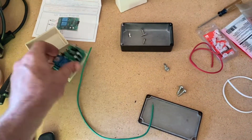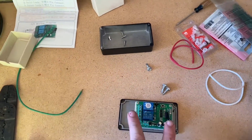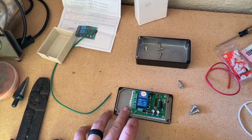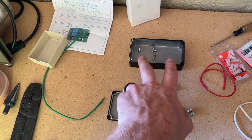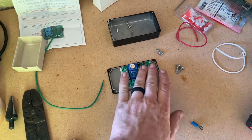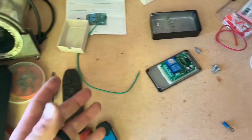What we're going to do is mount this guy starting off to this plate inside here, that way the switches inside this remote relay — or the relays — can straddle the two screws that I'm going to use to push through the box itself to mount to the winch plate. So we're going to go ahead and glue this to the metal lid and then we're going to start wiring.